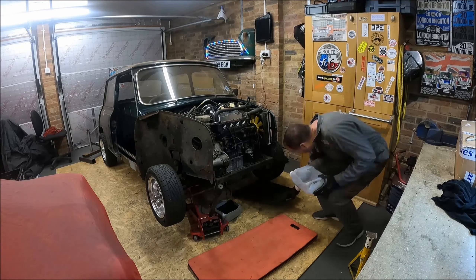As you can see, I've drained the oil and I've got a container underneath taking the coolant out. People have commented before that you can take the engine out with the gearbox and radiator on the side, and you can just about get it in and out without too much of a problem. But it is pretty tight, and for someone like me who's not in a rush, it does make it easier to take as much off the engine as you can. My reason for taking the radiator off was I wanted to get the water pump out as well, because the water pump is right at the very bottom of the engine, and by taking it out you get all the water out, so when you're moving the engine around afterwards you're not constantly dropping coolant on the floor.